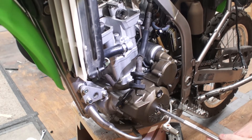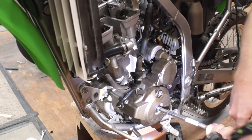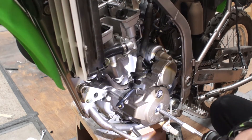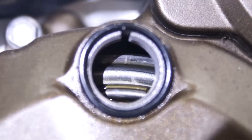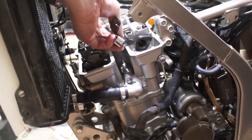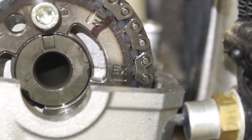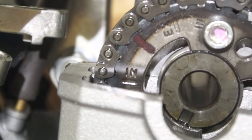I will now turn the crankshaft a couple of full turns so that the tensioner can apply tension on the chain — you should hear it click a few times as you're doing it. Then I'll set the cylinder to top dead center and recheck all valve clearances once again to make sure everything is as expected. If something's out of spec, I'll have to repeat the process. Just be sure to not reuse your old marks — once the engine has rotated, they're useless.